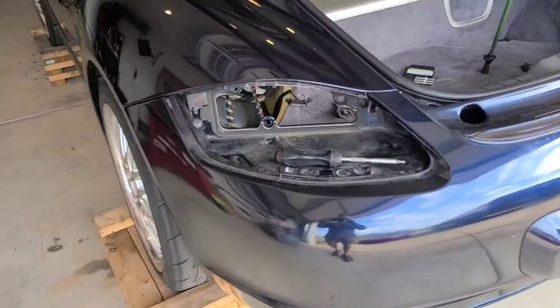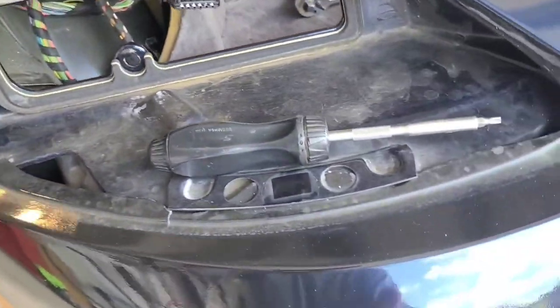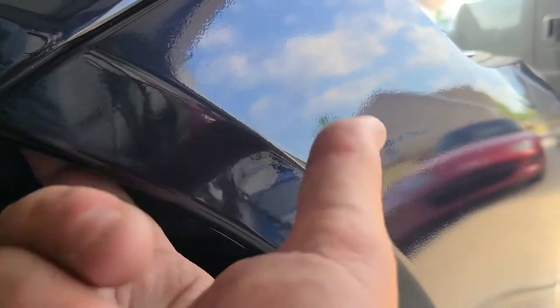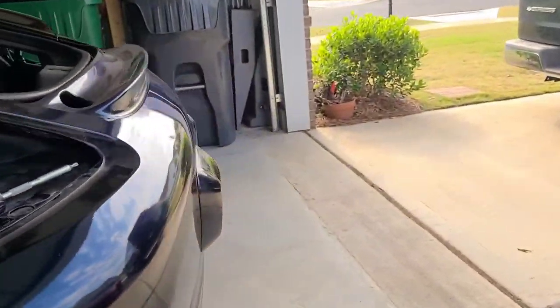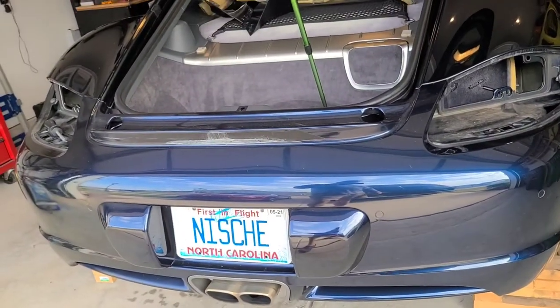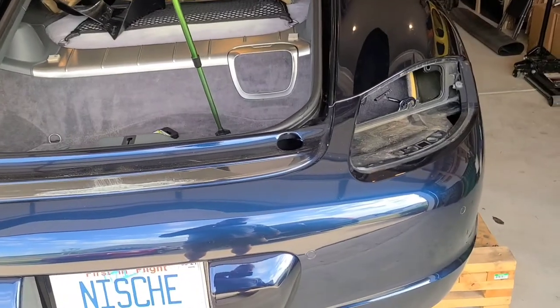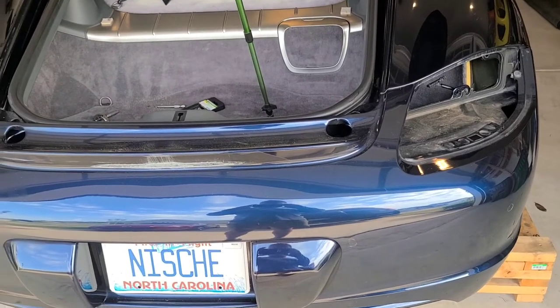About to remove the rear bumper cover. There are T25s - there's one there, one right there, and the trickiest one has its head facing sideways where my finger is. There's also a series that run across the bottom. It's just those T25s, and obviously there's a plug for the rear impact sensors. I'll get that going and show you when it's done.